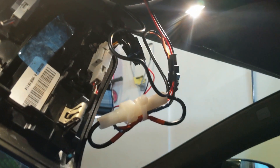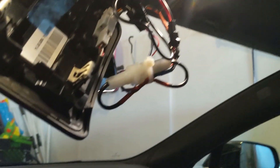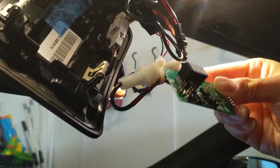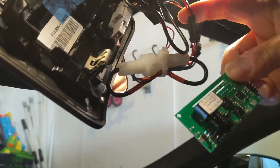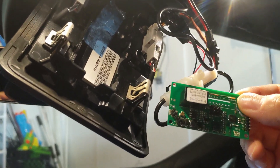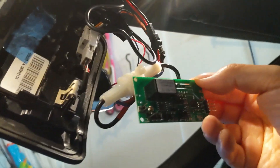Basically, the front and back are two-channel cameras each, so I will need to split these. The idea is that this relay switch will be put in between the Tesla hard wire and before it comes out from the splitter to the camera. I will now go inside to the house and solder the wires so this relay can be put in use.